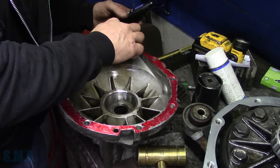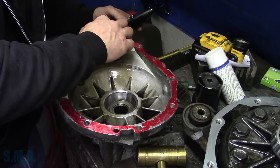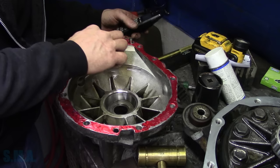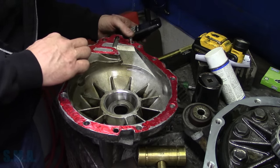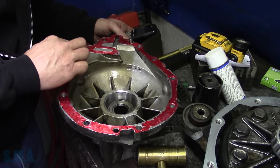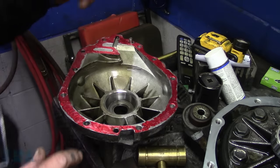I think she drives a Chevy Traverse. It's making a popping noise when she turns the steering wheel. Sounds like strut bearings to me, but. Markers are in the top of the blue cart over there to your left by the garbage can. So I just want to spread around the sealer here. So you said Melissa. Melissa, yeah, just right on Melissa. I know who it is. Yeah, Wednesday. Noise when turning steering wheel. Says slow speeds turning in town. She hears this noise. The way she describes it sounds like a strut bearing. But her husband says it's probably a ball joint, so we'll put ball joints in it first.